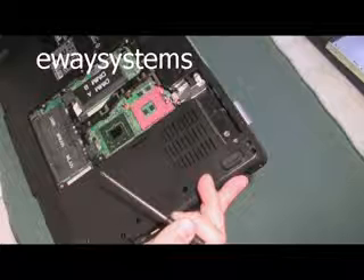When somebody spills something in a laptop, I don't even try to power it on. The first thing I do is pull the AC adapter out, power down the laptop, pull out the battery. You don't want any charge in this thing. That's the advice you should give somebody if they bring their computer in - pull that battery out, don't even try powering it on. We're going to have to open it up, clean every part inside first, and then see what happens, because you don't want to be responsible for frying the laptop.